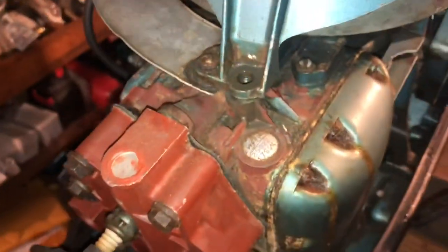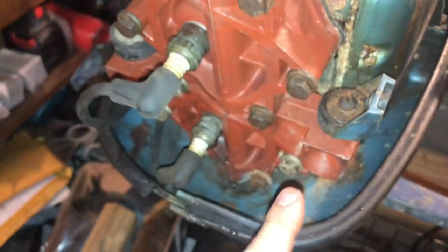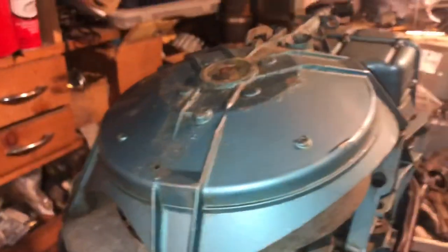Another bolt taken out — maybe they lost spark and compression and wanted to check it. Being that we have this setup here, maybe we will check for compression — that would be our first step. I want to get this bolt out of here, pop the spark plugs off, check inside the cylinder. One bolt came out and fell to the bottom; there's one missing here as well. It's got some oil on it — it might have been reused. He said it was stored for 30 years, so not really sure what's going on.